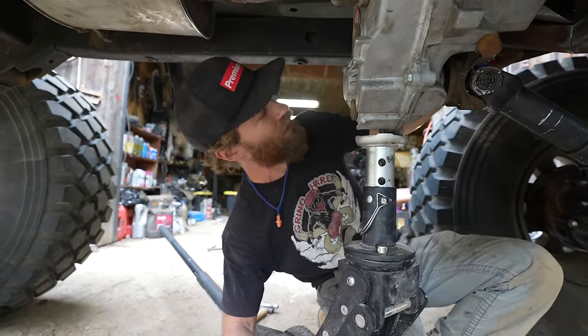All pass emissions. Yeah, and then these, I didn't even get around to this, but these need to be a little bit notched so the shackles can flex more too. Right now actually, that's our most limiting factor because otherwise this side could compress more. Yeah. So if we notch that out, it would flex even more.